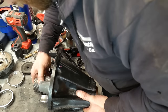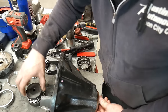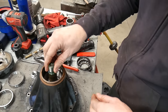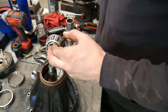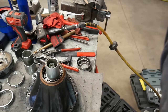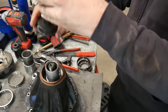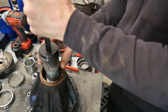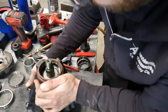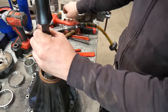Now we can install this into the housing. I'll stack up some spacers below the pinion and set the whole thing down on top of that spacer to hold the pinion up into the housing while I install the outer bearing. I apply a little bit of 80w90 to that bearing as well, then use the same drivers to install this bearing onto the pinion. I tapped that down until I bottomed out on the pinion, added another spacer, tapped it down a little bit further, then had to add another shim underneath the pinion to get it fully seated into the bearing. A few more taps and I fully seat this up against the crush sleeve — that's all I need to do right now and we'll get the rest tightened up later.